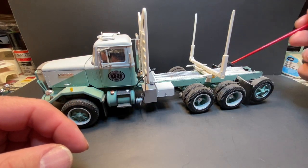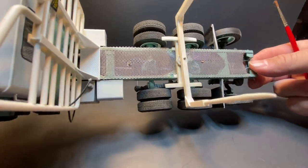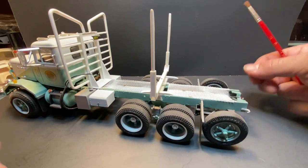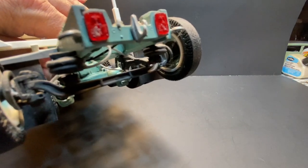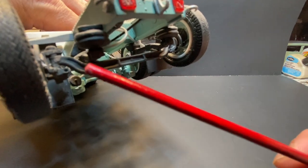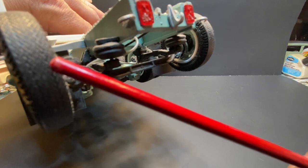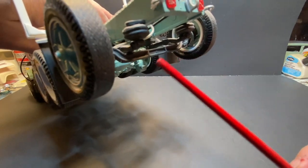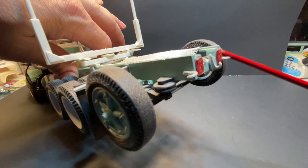This is all metal — aluminum deck plating mesh. The rear tag axle is a front axle off of a Peterbilt 359, with springs cut in half so it just goes up and down by airbag. I built it to be a steerable axle, so when turning corners this axle actually turns with it instead of binding up and dragging across the pavement. I made it into a steerable tag axle. It's got a pintle hitch on the back — that's what the trailer hooks to.